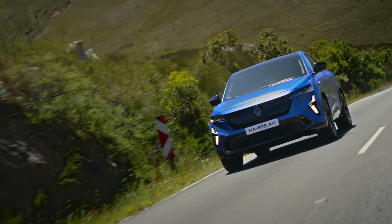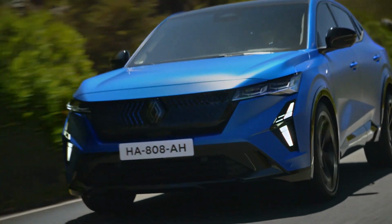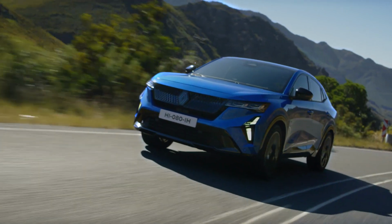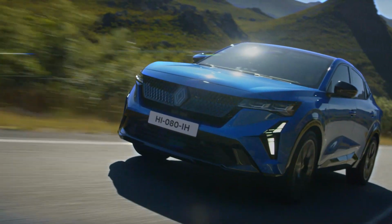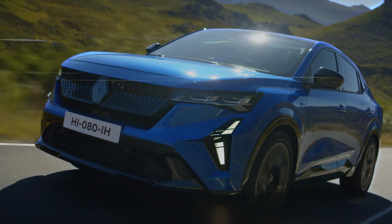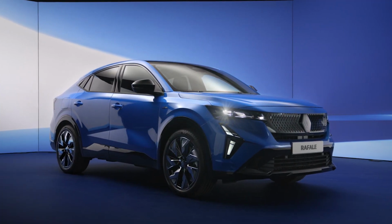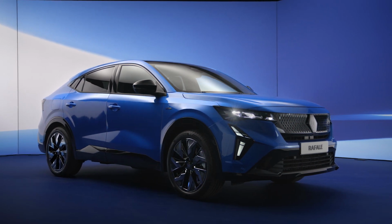When the repair is done, drive for about 2 miles or 3 kilometers at below 35 miles per hour, 60 kilometers per hour, in order to distribute the product uniformly in the tyre. Then stop and check the pressure. Please note that tyre pressures should only be checked when tyres are cold.